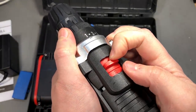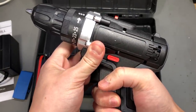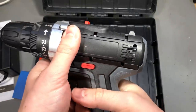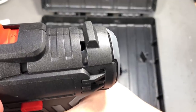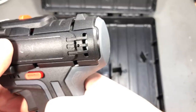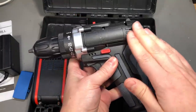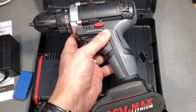Up here we have the switch for low or high range, and the drill feels like it has some kind of brake system when you stop pressing the switch. I can see some sparks in here through these vents, and they were claiming this is a brushless motor — but seeing sparks through these vents can only mean one thing: this is a brushed DC motor, and those sparks are coming from the brushes which sit behind the motor. Considering the price range that isn't necessarily surprising, and with moderate usage it would probably last enough with a brushed motor — it's just that the product description said otherwise, and that's not a nice thing.